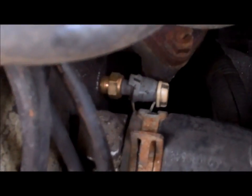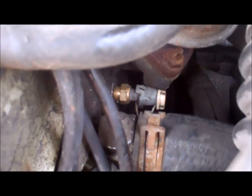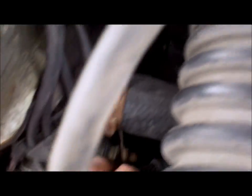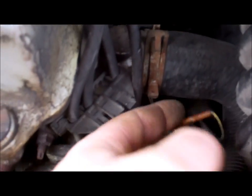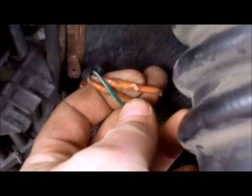I look at these sensors and they look almost brand new, like someone's replaced them before. There's one there, and there's one just below it. The top one only has one wire going to it, and that goes up to your instrument panel to show you the engine temperature. The lower one, which has two wires, is what controls your fan and tells your computer when to turn them on. Since these sensors look like they've been replaced and someone's done some botched wiring, that means we have an issue somewhere else in the car. But now you know how to check your OBD1 GM system for codes without buying one of those expensive code readers. All you need is Google and a little piece of wire.